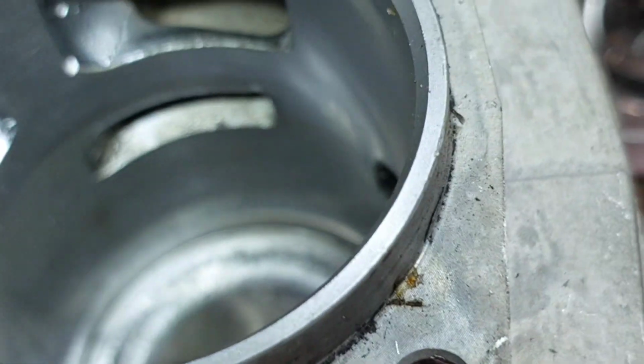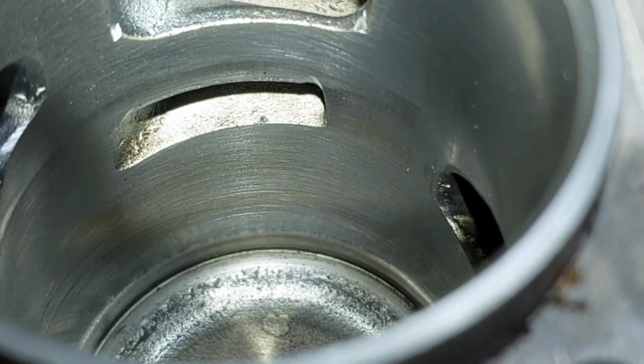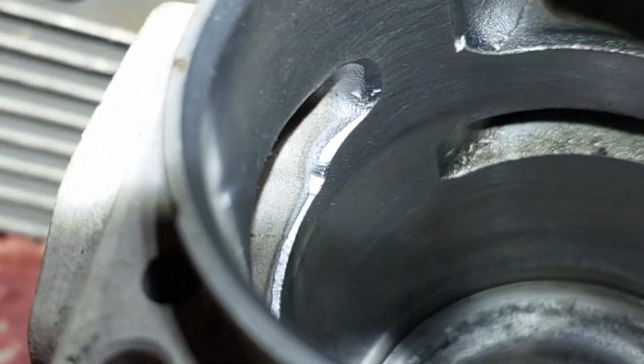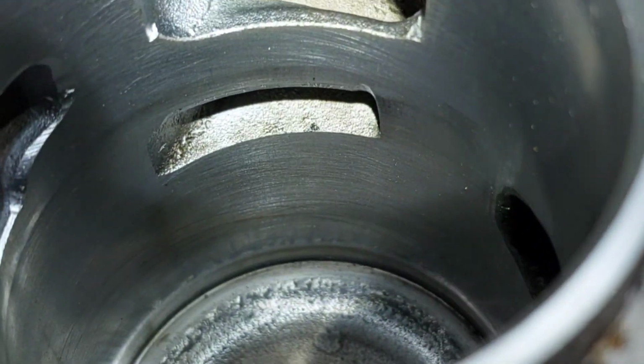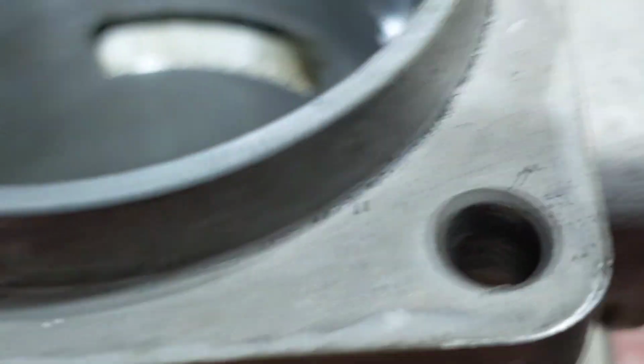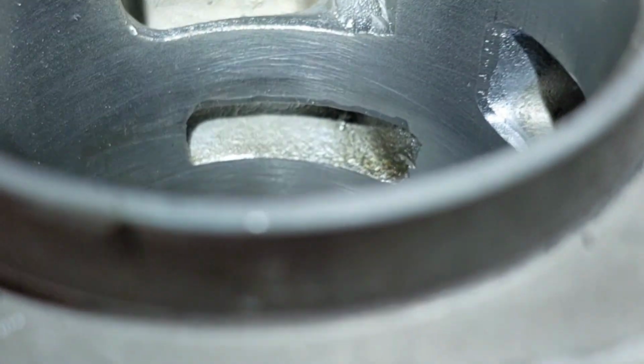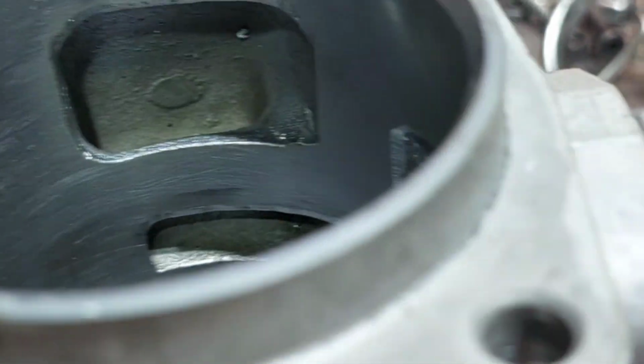You see, that upper transfer is directed towards the carby. It's on an angle, so it goes down. That's the carby just there. Take the side view, so it droops to the left. Turn it right around, you see it droop to the right. It's not straight off. It's drooping, and that's why I like that.